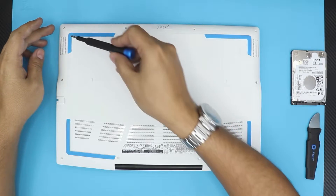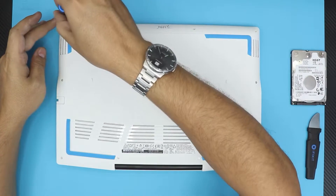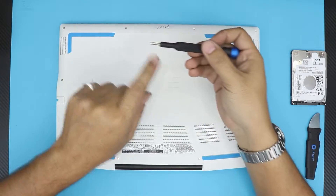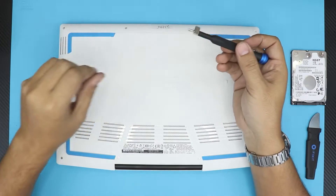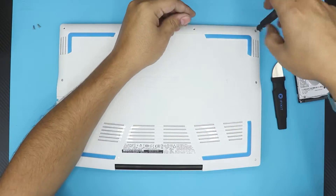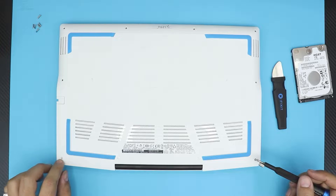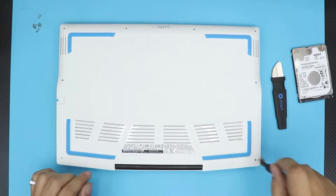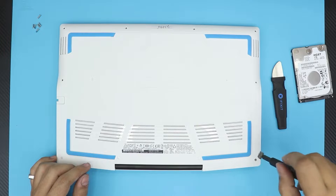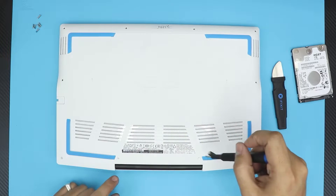What you're going to do is remove all the screws — the back screws on the bottom cover — starting from the front end of the laptop. I usually put a magnet on this one so I can actually pick up the screws. The back screws by the hinge have a c-lock protection on them so they won't actually come out; you can just loosen them. You're going to hear a click sound, and that's where you're meant to stop.